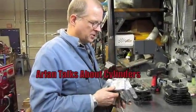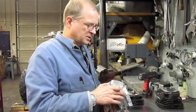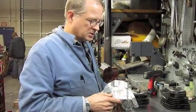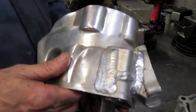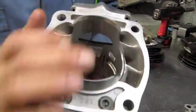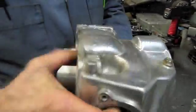This is an old Pro-X cylinder that we've reinforced. The first few Pro-X cylinders had a tendency to break the reed valve area right through here, so we've welded a lug in here and reinforced the cylinder. We'll run longer studs, put a sleeve in it as well, so when we're done porting and reinforcing, this will be just as good as new.